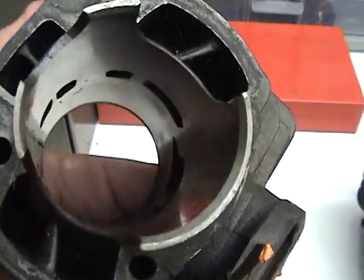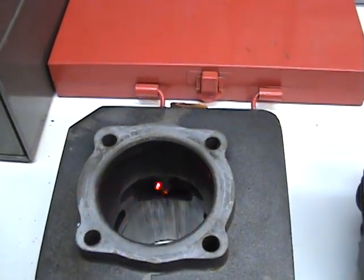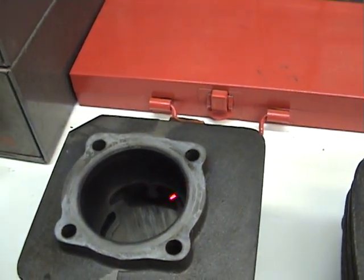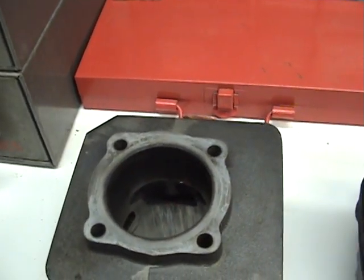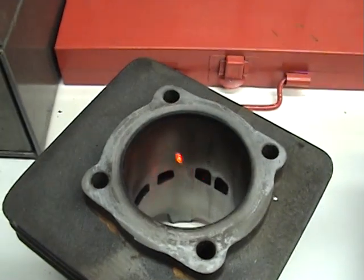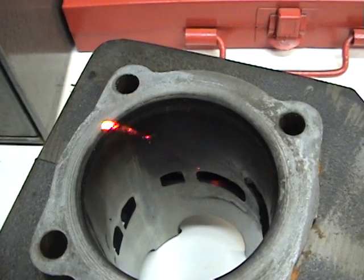There should be some small scratch marks along the edges — that's just normal. But what I have here is a lot of buildup along this wing and in the cylinder port, which shows that it's not getting a good evacuation. I've got seize marks right down in here, and I've got carbon up in here which shows ring failure. The back looks pretty good with a couple small marks, but over here on one side you'll notice it's dark right here — and that's ring failure right there.